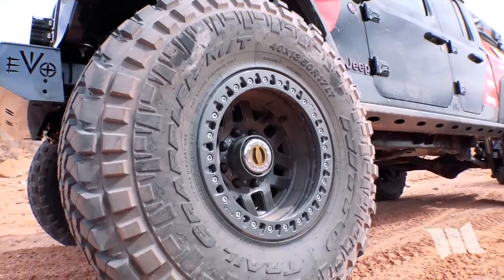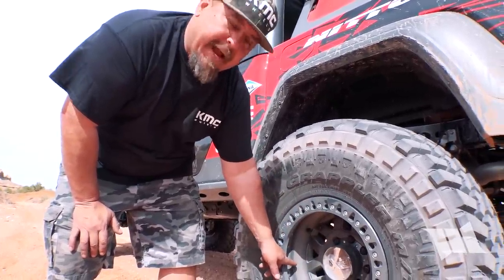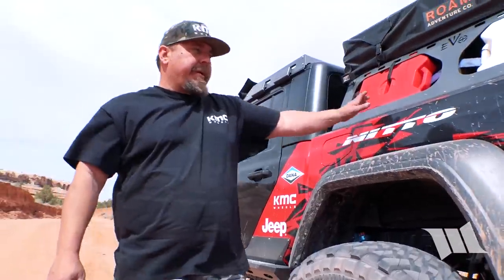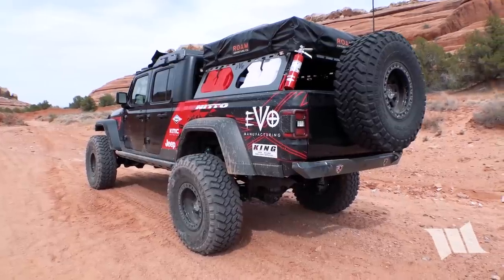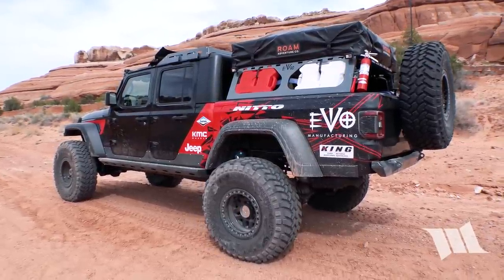All of our aftermarket accessories we did in that metallic gray — kind of tied it all together. We wrapped it last minute; David Brumby drew out a really nice color scheme for us and we had it wrapped literally at midnight the night before we left. Believe it or not, I haven't programmed anything. Bolting in aftermarket axles with the regular speed sensors and 5.38 gears — didn't have any traction control lights, ABS, or squiggly lines going off on these Dana Spicer axles. So you can just bolt them in and go.